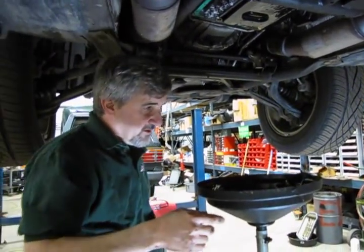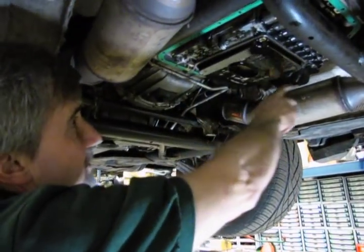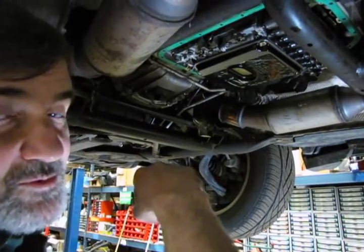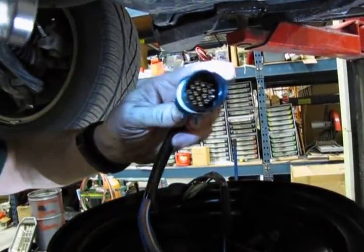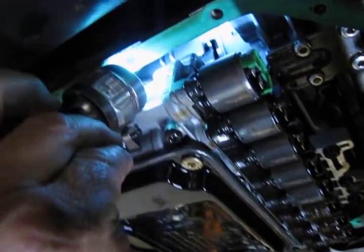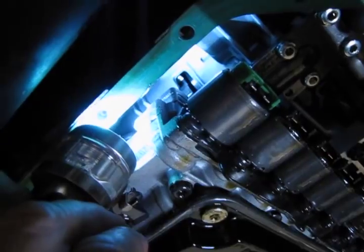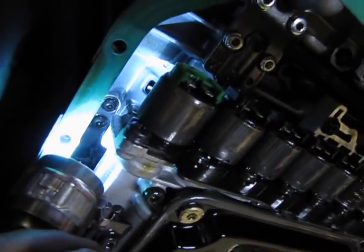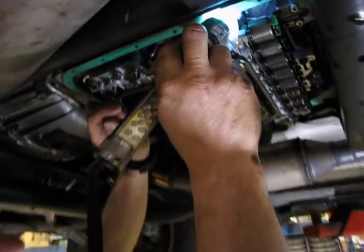Essentially installing the harness is just the opposite of the way you pulled it out. Then we're going to put a little bit of high-tack or a little bit of sealer on the gasket just to get the pan side ready, get the pan bolted back in place, and then we'll go through our refill procedure. If you look at the connector before we install it, you'll see a single tab up top and a double tab on the bottom. The single tab is going to have to line up with that slot all the way up at the top of the transmission casing. What you're also going to do is put a light coating of transmission fluid on the two o-rings on the new harness so that it slides in a little easier for you.